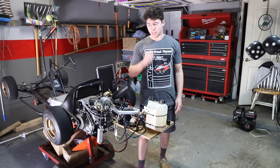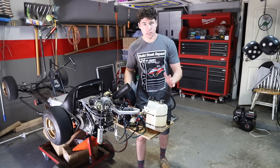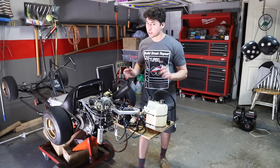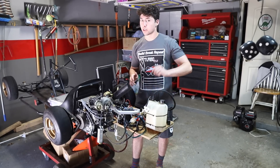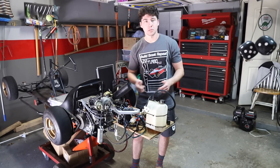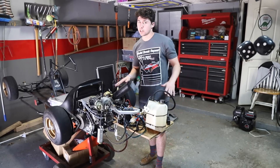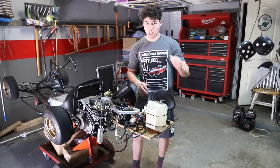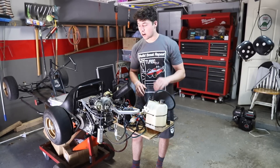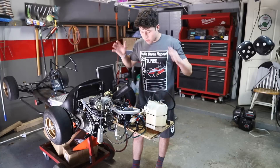What we're thinking of doing is changing all this up and doing a final installation on the turbo cart, let it self-tune a little bit. I know some of y'all don't really like the self-tuning features at Ecotrons, so we talked to John and Isaac at Cars and Cameras and they had no issues with it. So I think we're going to get a baseline self-tune and then we can do some data logging and adjust wherever we need in the curve.